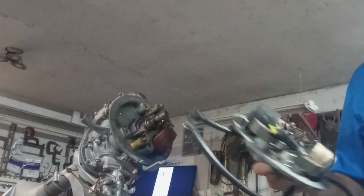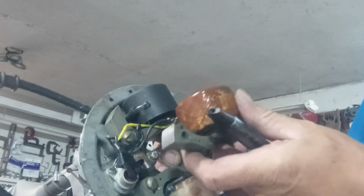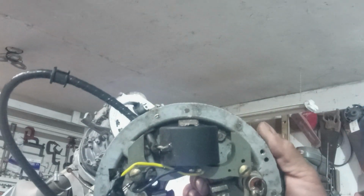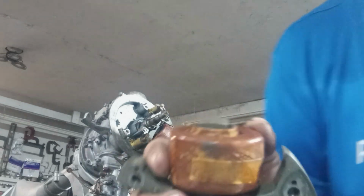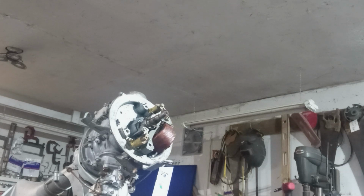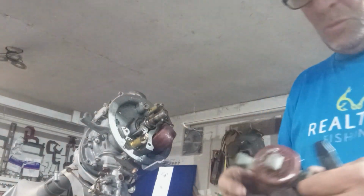They're totally different. Before I go too far, I'm going to test this coil, but see, they're different. This is the Scott Atwater laminate. It's got pretty much equal shaped, equidistant laminates. Now this one has one on this side, but the other side is completely different. So after I get these all off of here, I have to take the Scott Atwater flywheel off, slide these coils on along with all this ignition, the points and condensers.